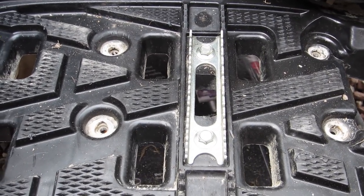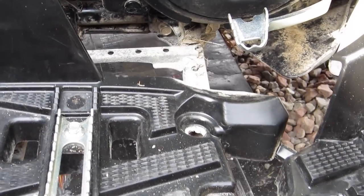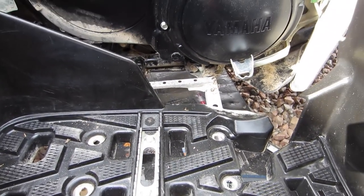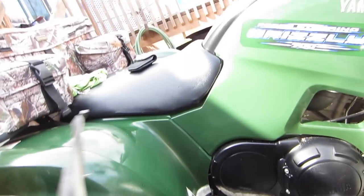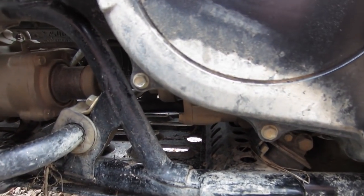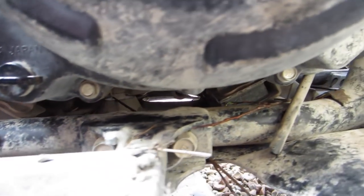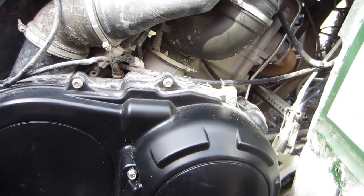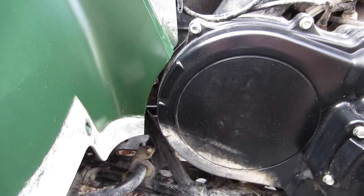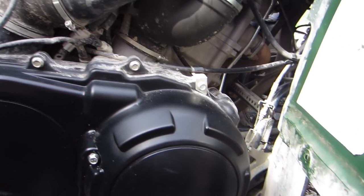You don't have to take those two bolts off on the foot peg — she just comes off. She's dirty in there without taking them off. You can take those to the side; now you can see your bolts. You've got to remove the 10mm heads on them. I took the side panel off just so you can see the bolts better and give me more room.